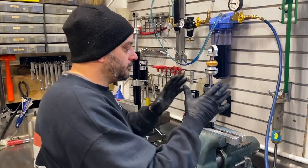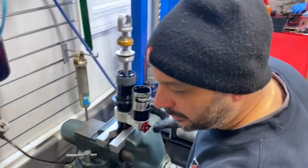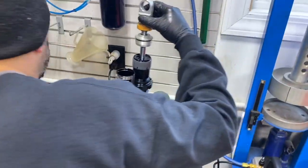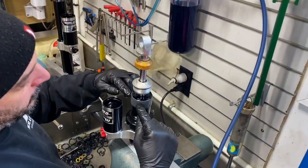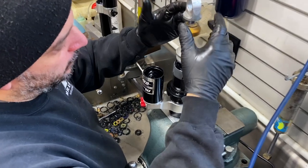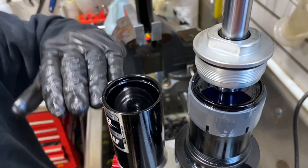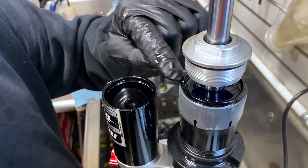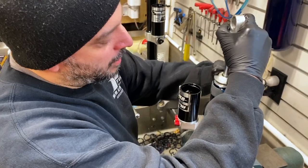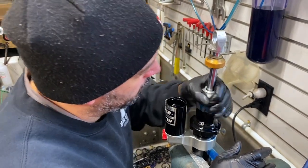I'm going to finish putting this together — it's already done bleeding and I'm going to charge it. In this process we're going to just top off a little bit of oil. You want to make sure that the piston's up at the top, maybe a quarter of an inch below in the threaded area. Set your floating piston height to whatever the shock calls for. In this particular case I bottom it out, bring it up about a quarter of an inch, oil's full. Then you're going to set the seal head — oil is going to come out, which you want, because you want to displace any air underneath that seal head cap when you're tightening it.